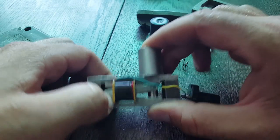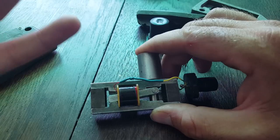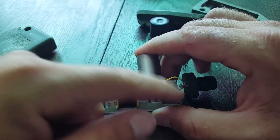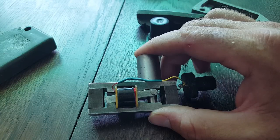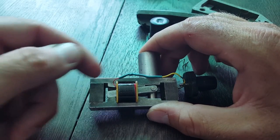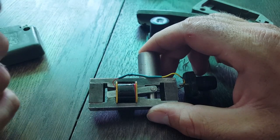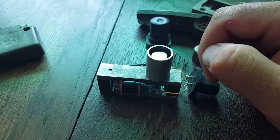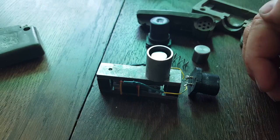Like I said, the first click I'm not sure about. I assumed it was something to do with the strength of the magnets, but there wasn't much magnetic field to start off with, and after I took it apart everything just went to shit. After I installed the other two magnets, I still wasn't getting it. So if anyone has an idea of how that works, let me know. Basically what it does is the first click induces a positive voltage, and then when it releases and comes back up there's a negative voltage — the current goes in two different directions. The 3 volts is enough to set off a number 6 blasting cap with apparently 100 feet of wire.